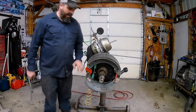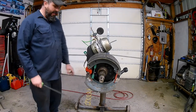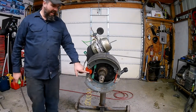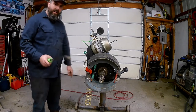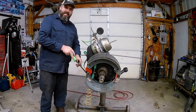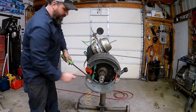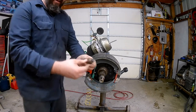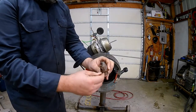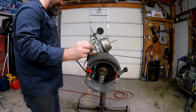Our next step is to take a little tension off this return spring. The best thing to do is take out our rollers next. We're going to take a pry bar, put it down behind here - watch your fingers, sometimes it does kick out on you. You're just going to pry down just a little bit. You'll see these little rollers - they just unhook out of there. It's just a simple little squeeze clip on there that holds them in; they pop out pretty easy.